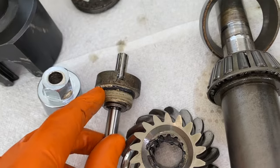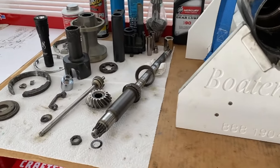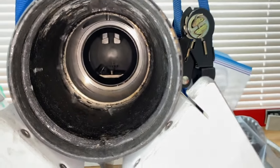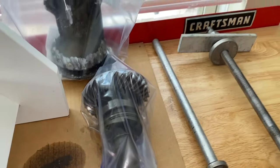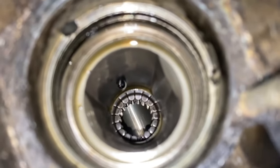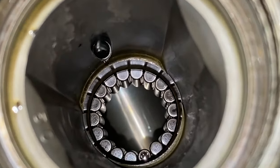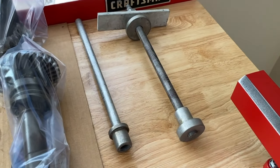Back to the table — here is the metal washer, rubber washer, O-ring, and additional washer we removed from the top portion of the bushing. We are going to install all brand new parts. We are now going to remove the pinion gear bearing. On the left-hand side is our drive shaft, pinion gear, shift shaft, and crank. On the right-hand side is our propeller shaft with the clutch dog and forward gear. In this video, we are going to replace the internal pinion bearing. On the left-hand side is the removal tool and on the right-hand side is the install tool. Going up top — this is the drive shaft cavity, where the drive shaft shifts down through the bearing, as well as the lower pinion gear, and is secured with the pinion gear nut. In our case we have 18 needle bearings.